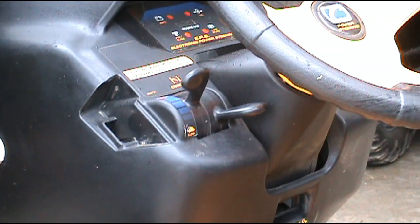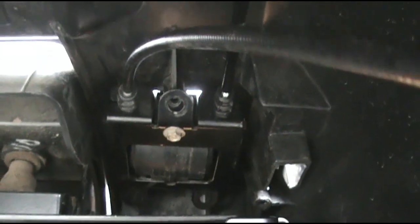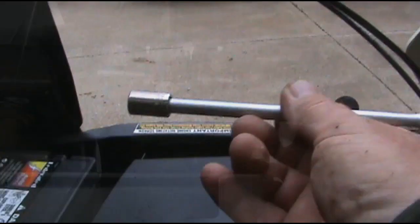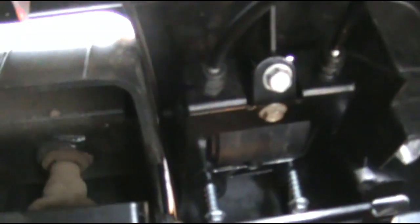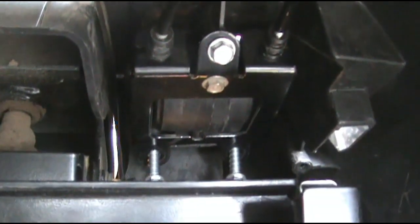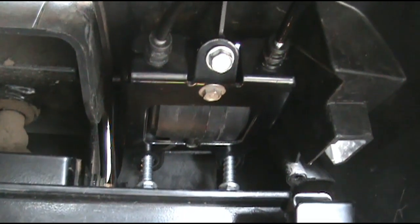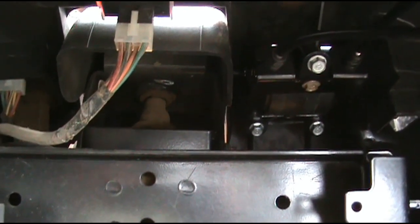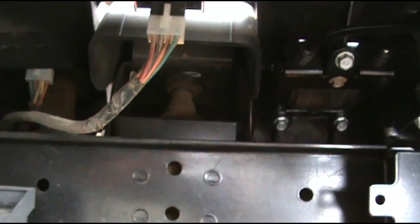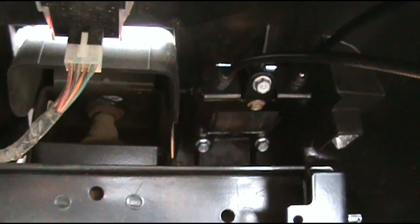Now I'll go ahead and bolt this in on the inside. Okay, as you can see, there's 3 places to put bolts, and that's where I'll put them. 1 at the top, 2 back there in the back. I'll use this extension with a 3/8 to put those screws right there in. Now I'm going to go ahead and get in here and put a ratchet on the end of it and take them on in slowly. Now that we got those tight, we can drop everything down and start putting other bolts on, because that was our main concern right there, getting all that attached.